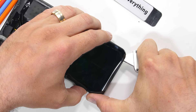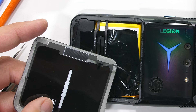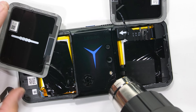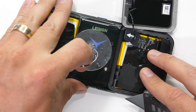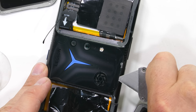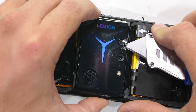Aside from the whole breaking in half thing, this phone is legitimately pretty cool. The other side of the phone opens up in the same way with another thin ribbon connected to another one of the capacitive programmable triggers – two down, six to go. The inner third glass section though is more difficult. It's recessed into the frame with no antenna lines or easy suction cup access to help lift off the glass. Eventually I do get some penetration with my razor blade, but it still does break. I hate it when that happens.